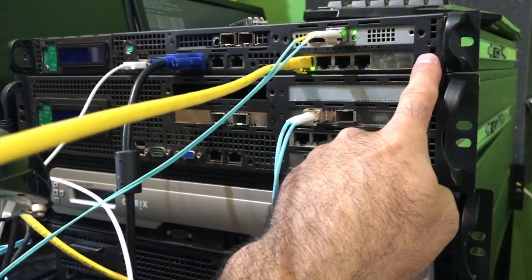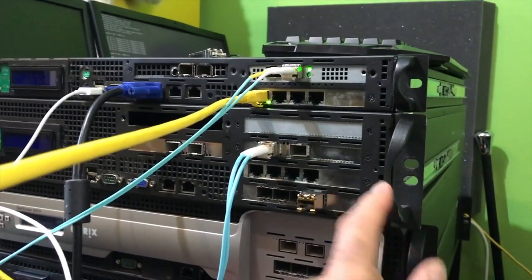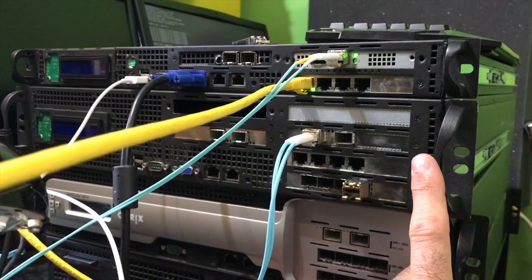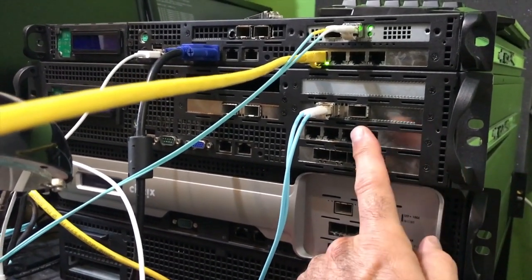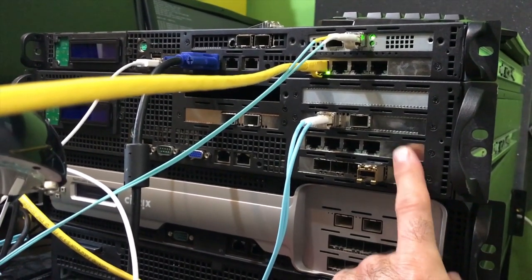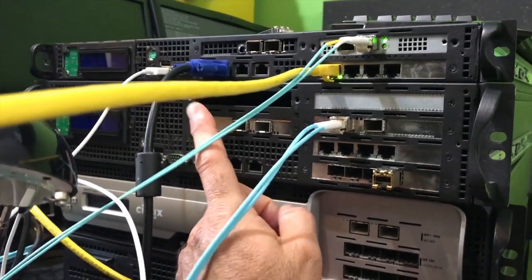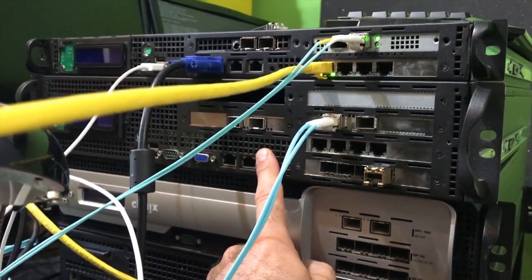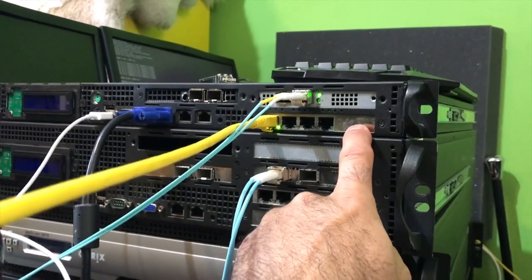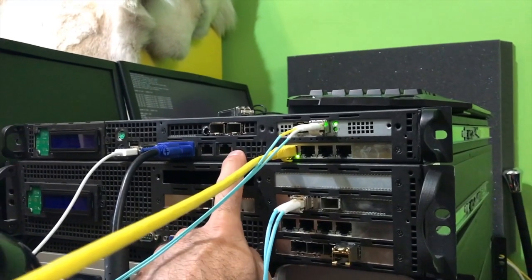Essentially, I upgraded this 7500, and the great thing about the 7500 is that these are identical units, just the 10,500 has more processors and more memory, and a different riser card. And that's the problem: the 10,500, because of how it was configured, has a riser card with an X8 and two X4s on one side, and on the other side two X4 slots. So the X4 slot will not support a dual 10 gigabit interface. Whereas the 7500 has two X8 slots on the one side and a single X8 slot on the other side.